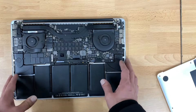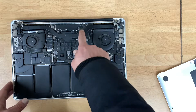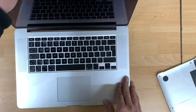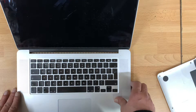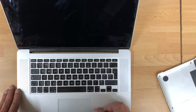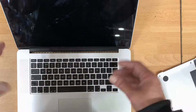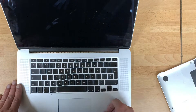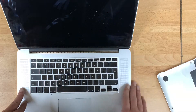When it came in it had no display at all — power on, fan was spinning, no display. After reflowing the GPU and powering on the machine, it had no operating system on it, just showing the folder sign. I reinstalled Catalina and during the OS installation I had no problem at all — it just switched off randomly once or twice, but powered on again and worked fine. It is working fine now, but I've seen one more problem that I'll keep working on.